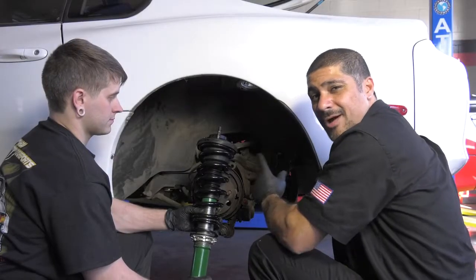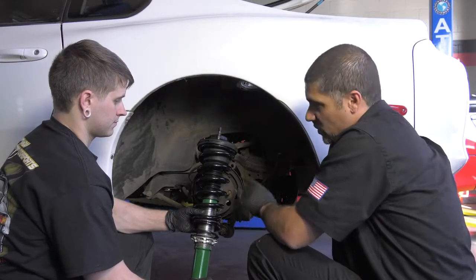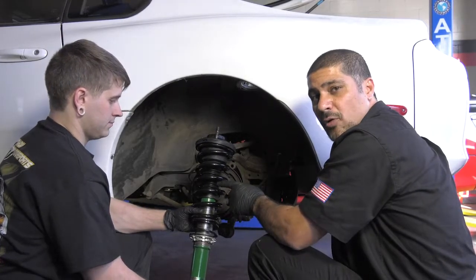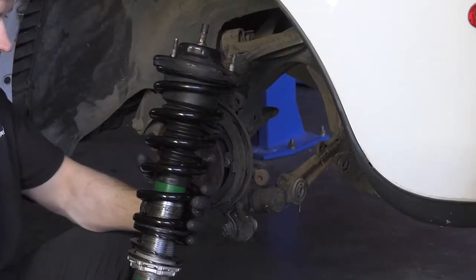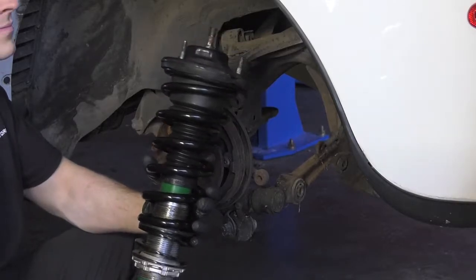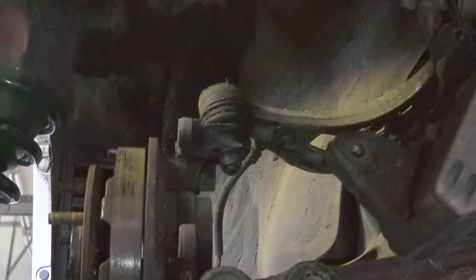Now this car is gonna have 800 horsepower. And the last thing you wanna do is have a sloppy suspension. And so what we're gonna do is put in a set of coilovers, which gives us dampening adjustments, rebound adjustment, and ride height adjustment. You can also adjust your spring rate with the corners if you have cornering scales and you do some road racing.